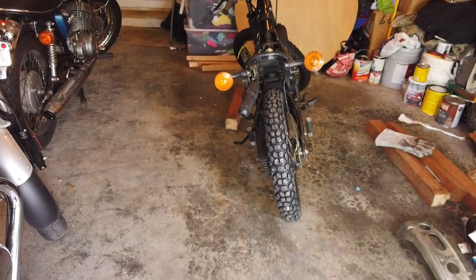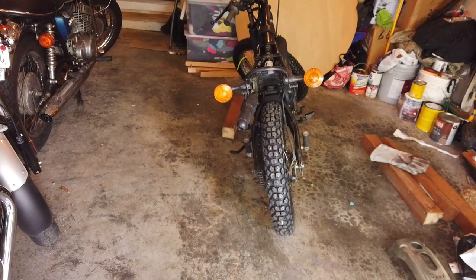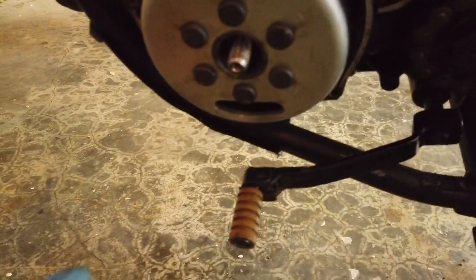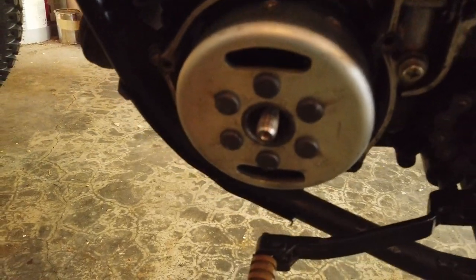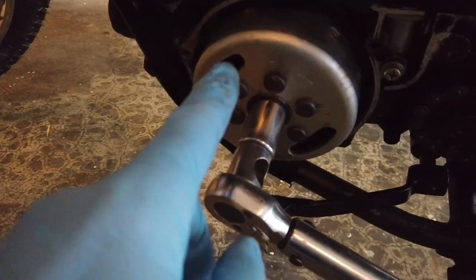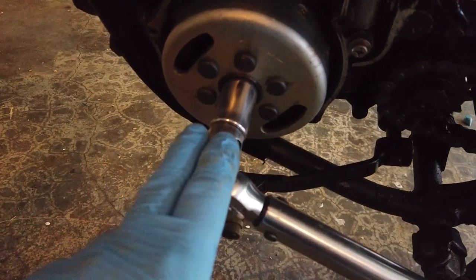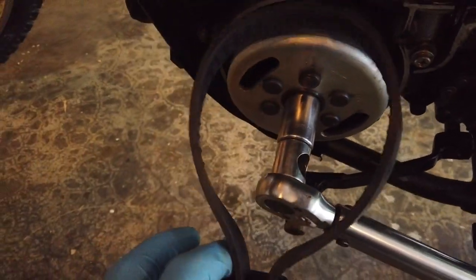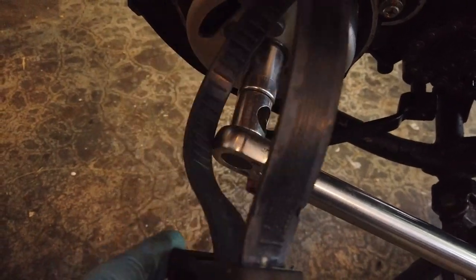Actually, I could start taking the seals out. Especially I could take the seal out on the other side here — the magneto — let me do that. That came off pretty easy. This has never been off before so I'm going to take off the seal on this side. I torqued this up last night to 40 pounds, holding it with a Harbor Freight belt strap.